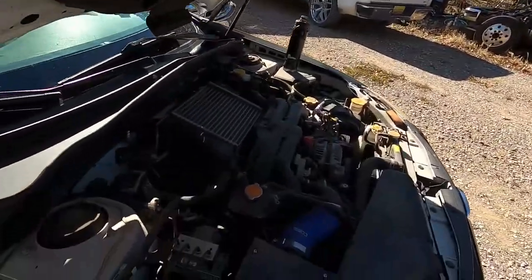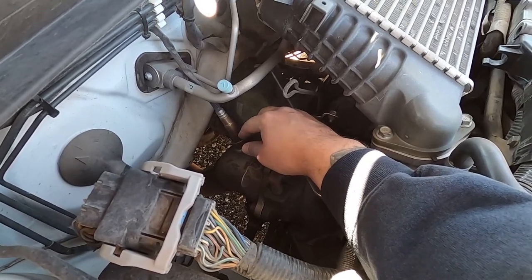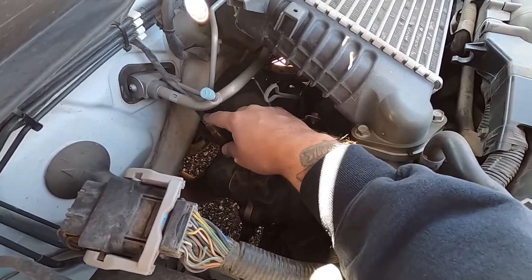My Innovate wideband — and if y'all have ever heard me complain about the Innovate wideband — it hasn't worked in like two years. I've gone through two sensors, and those sensors are $75 a piece, so I spent $150 on two sensors. Calibrated them, everything. They work for like a week and then they're gone. Innovate says you need their proprietary heat sink, which is like another $60 or $70, to space the O2 sensor higher up in the bung. I still haven't done that because I'm already butthurt about the money I've spent for no fix. So I can't see my air-to-fuel ratio — I don't know if it's fuel, spark, or what.